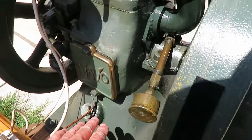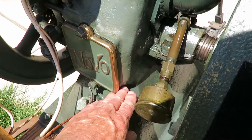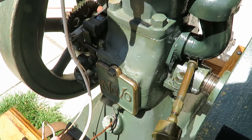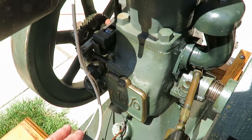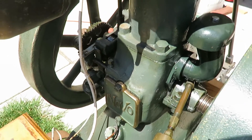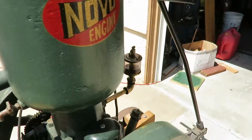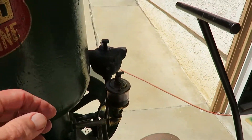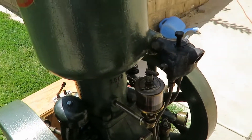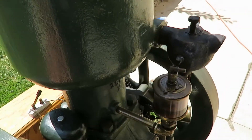This is the gas tank down on the bottom here, and then the oil is in this section right here. You put in just enough so the nuts on the rod dip into it, and as it splashes, it splashes oil up on the cylinder walls. And then this oiler — you turn it on so it drips just five or six times a minute — and that oil is for the piston pin.